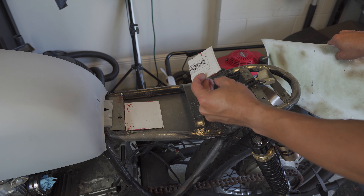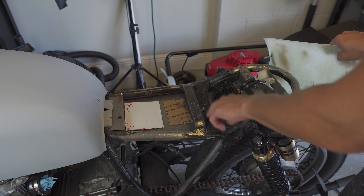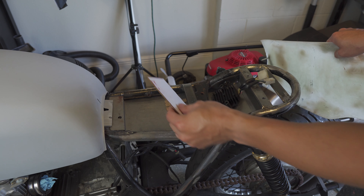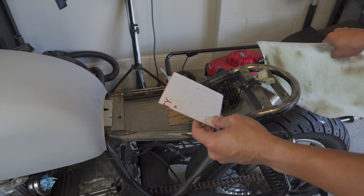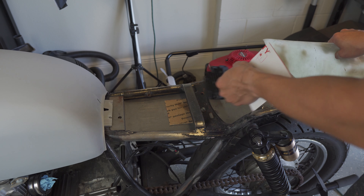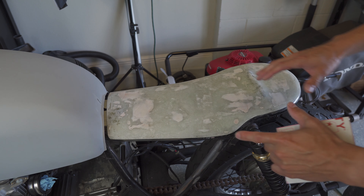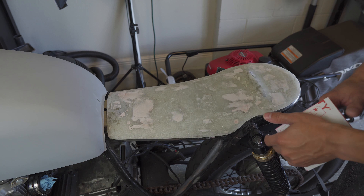This is the size of the Moto Gadget M-Unit Blue, so trying to figure out spacing for all the parts. I also have the CDIs that can fit here, and there's going to be a lot of wiring and cabling laid into this space. I think the battery is going to be where the dual stand hooks up, so I won't be needing that and I'll have more space than I thought. Now that the seat pan is finished, I have one-inch foam that I'm going to glue over the top, do a little shaping, and see if I can vinyl wrap it. I'm considering taking it to a professional, but I'd like to do as much of this project in my garage as I can.